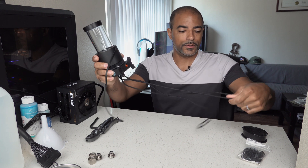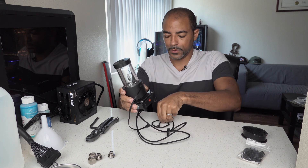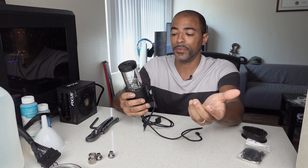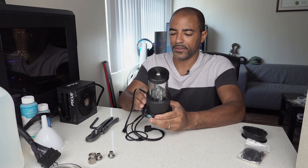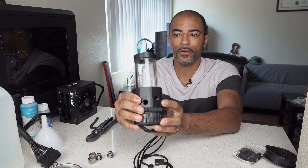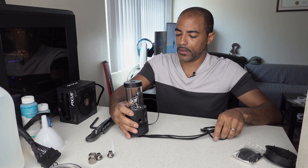Here is the 12-volt RGB connector. Here is the Molex connector — we're going to plug this into the power supply. And then this is the PWM cable so you can plug this into the motherboard to adjust the pump speed. Currently the one I have in Deep Blue, I just leave it at 100% speed — it's quiet as can be, so I absolutely love it. And then of course the sticker here — you pull that off after you've successfully installed this in the system. You'll see two holes up front: there's an in and an out, and of course the fill port up top. So we're going to be using all three right now.